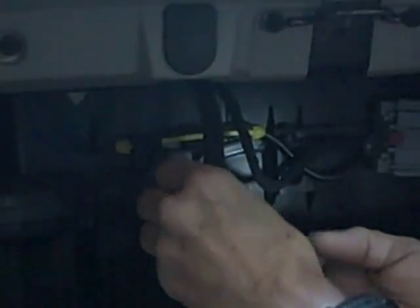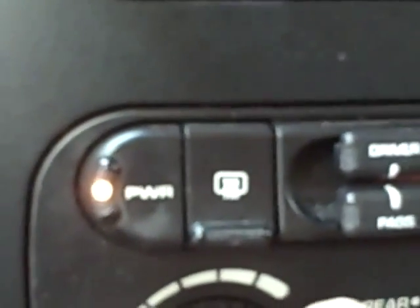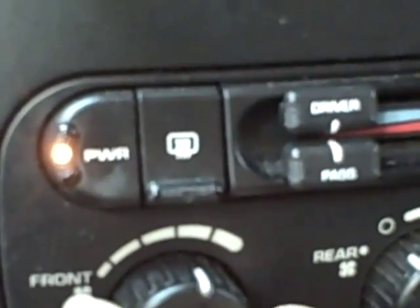Put the cable, snap in the wire housing — hear it click. Now you're going to test it out: low, higher — yep, all work. It was all just right beside the glove box, real easy. That's changing your blower.